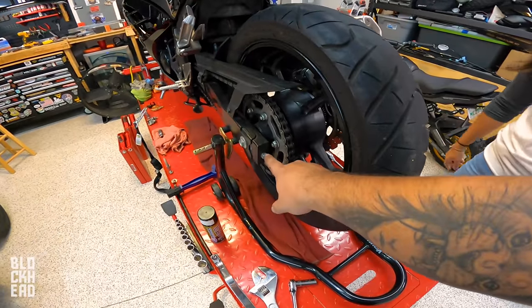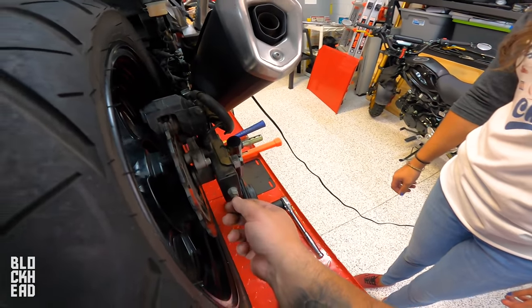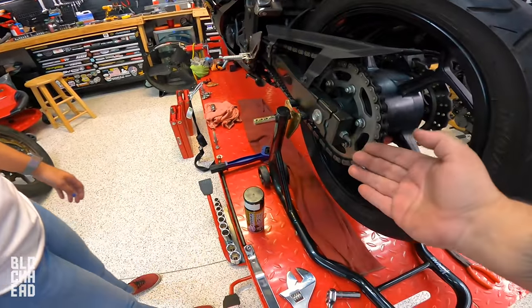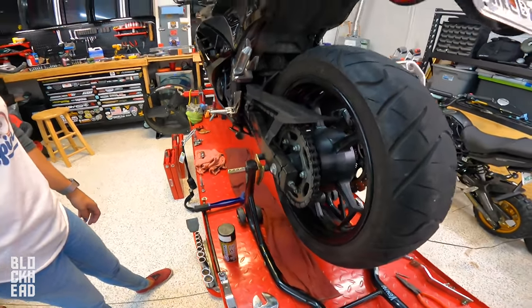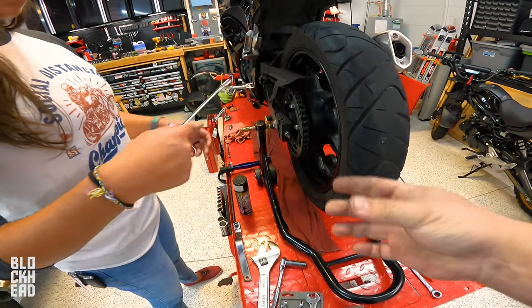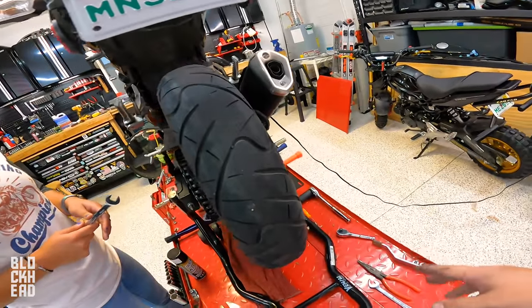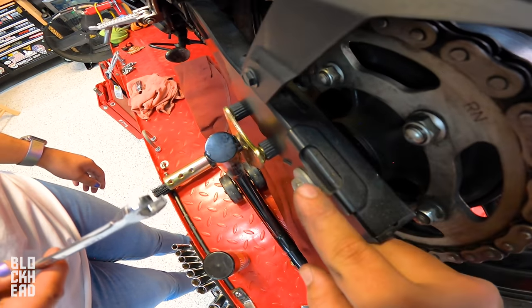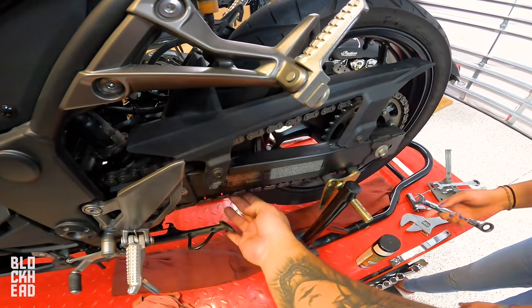That's good. So now we need to loosen these — well, this is actually what we're going to use to tension it. These are loose now, these are your chain tensioners. So you back it off and press it forward, it adds slack to the chain; tighten it and it basically pulls the axle back. We want about an inch and a half of slack — we got a lot of slack right now. So chain tensioning, you want to kind of evenly do it, like three or four turns here, three or four there, and pay attention to how many marks it goes back. You've got a little mark there and lines here so you can see how far you're moving, and as you're doing it you're going to feel the slack come out of it.